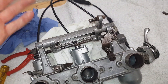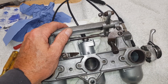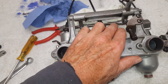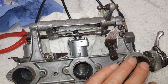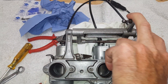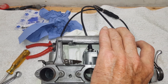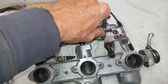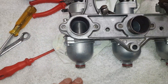It took until about half-throttle before that last one started to open, and that was the problem. It was simply a worn throttle rod. I replaced it and it's been great ever since. I'm not joking - it took me two or three years of messing about with the carbs, changing all the settings, trying to work out what the problem was. I was doing all my synchronizations and it was simply that the gantry itself was worn and wasn't lifting the carbs evenly. Of course at half-open or fully open you don't notice the unevenness, but when you're just off throttle or on idle you really notice it.